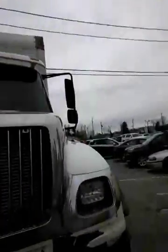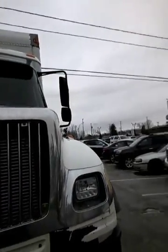So up there, boys, your clearance lights. You check that they're good. No cracks in the windshield. You say your hood secure, grill secure, bumper secure. Make sure your license plate is up to date. Usually this will be blinking. So you just check your headlights working, reflector, turn signal's working. Frame is good.